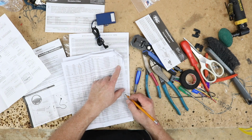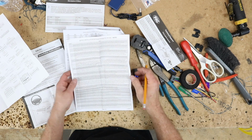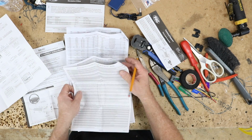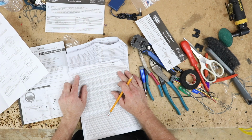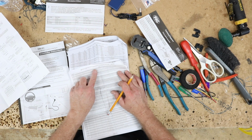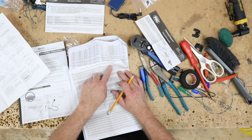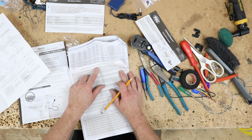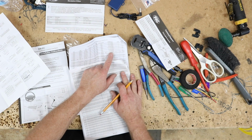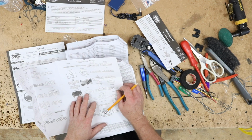And then if we want to look at the note, it is note 39, which is on this piece of paper, which is going to be page 2. In page 2, note 39 reads, white wire to pin 10, white black, to vehicle connector. Connect pin 9, brown yellow, of the radio connector to chassis ground. So always make sure you go and read the notes, because they don't always put that secondary ground on this portion.